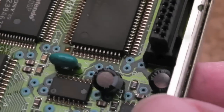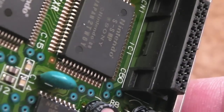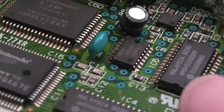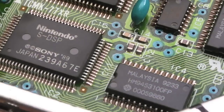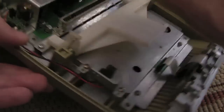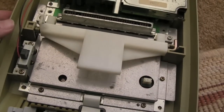It's nice that it's modular like that — quite cool. So we're part way reassembled there. I've got some heat sink compound on the 7805 now, cleaned up and vacuumed out a bit. I just thought to show you this in case you dismantle one of these yourself and you're not entirely sure how it goes back together.